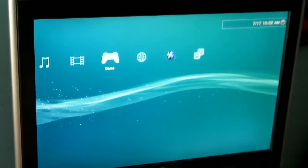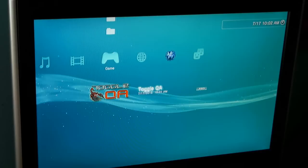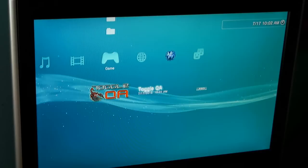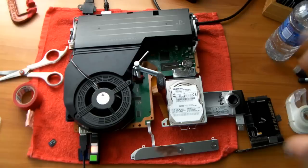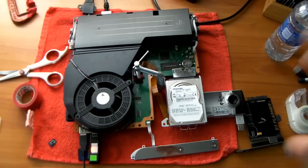I have my USB — plug it into the right-hand slot of your PS3's USB ports. Scroll over to Install Package Files — it'll detect toggle_qa.pkg. Click on it and run it. Your PS3 should beep three times, the screen should turn black and exit out. Now you're ready to install something like CFW 3.55 or official firmware — that's up to you. If you don't know how, go to my video on how to install custom firmware.